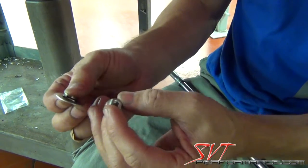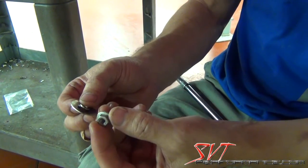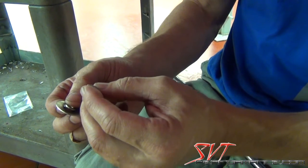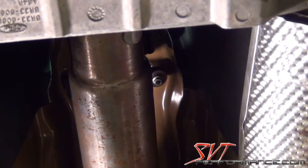So you want to utilize the fender washer, the lock washer, and some of the blue Loctite to put on the nut when you tighten it up, and then just use wrist pressure with your ratchet driver. Do not over tighten these 2 bolts. And again, we have to use a deep well 10mm socket for clearance of the studs.